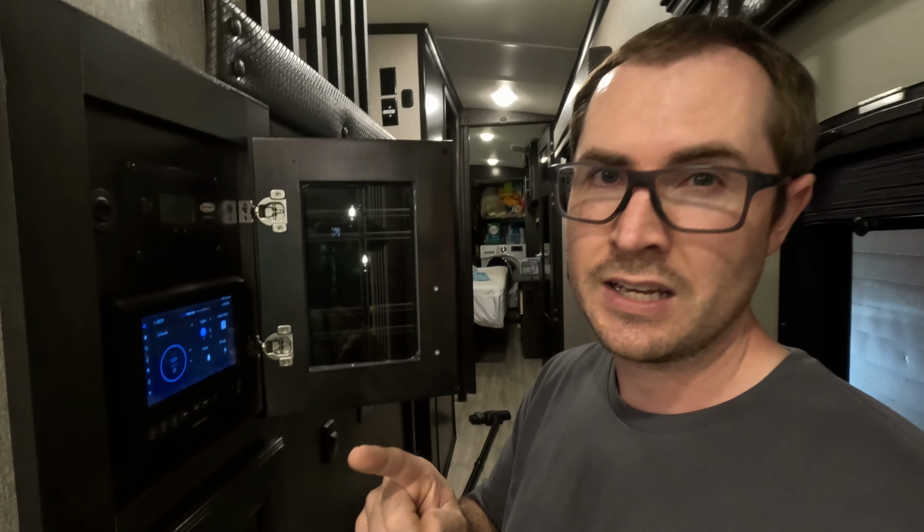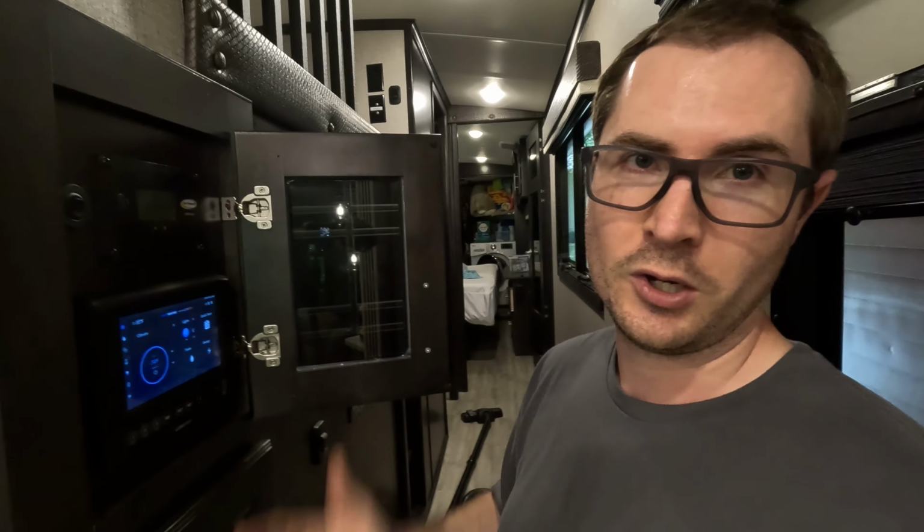Because worst case, I've seen this happen before, where a lithium battery gets to the end of its life and it starts expanding. And if it expands, it could very well crack the screen or damage other things internally, and then you got to replace the whole thing. So I'd almost recommend just keeping an eye on it, maybe proactively replacing the battery.